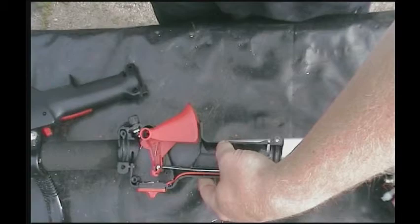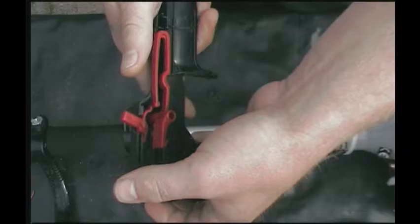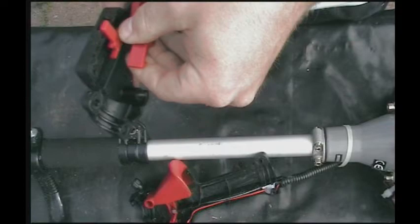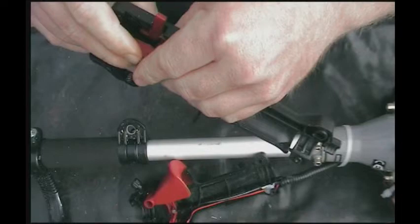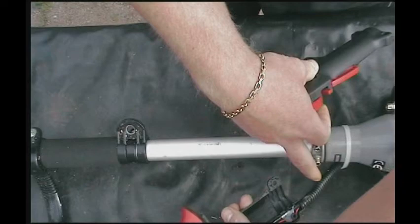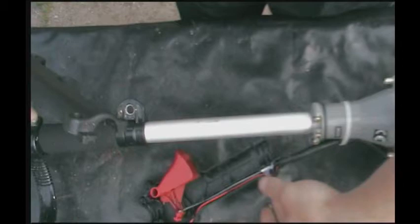Now to put the handle back together. This mechanism here I've just disabled because I never use it — in my opinion it's useless. I never want to rev it at semi-full max anyway, so I just sort of disabled it. But for the sake of this we can try to put it in. This lead of wires is going to fit between the two torx screws, as you can see — it's got to fit in between those two torx screws to make it fit.